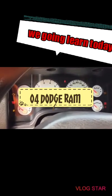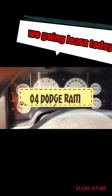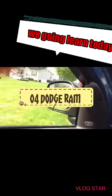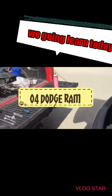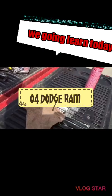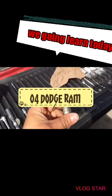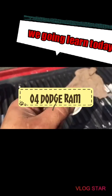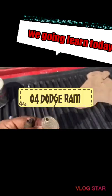So it kind of goes and shuts off. I just bought new spark plugs - all 16. I checked the gap on the ones that were on there and it went all the way to 0.100, so they were really bad.